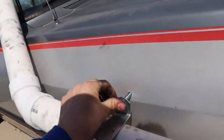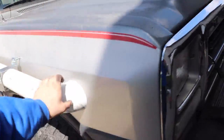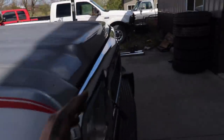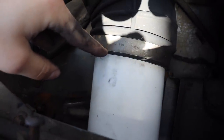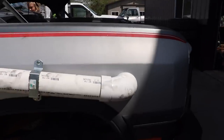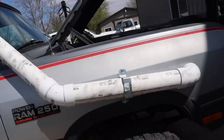I got the intake on the truck, got the hardware put on there. Hey babe, if you could pop the hood that would be great. So the four-inch actually mounts up to the factory intake perfectly. The factory intake hose that comes off is a four-and-a-half-inch inlet on the inside and five inches outside to outside, so it mounts up to that flawlessly — no weird big gaps where the hole is cut. It's a really clean and tight fitment.